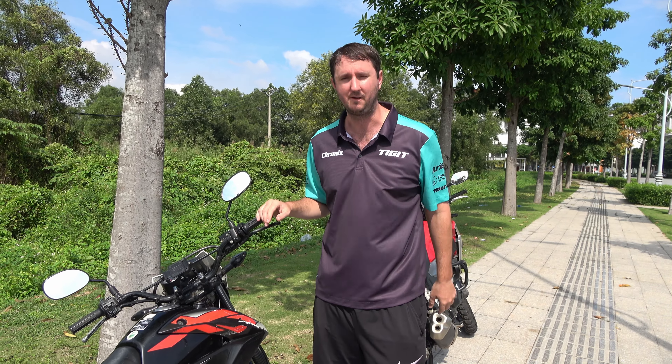You can run out of oil in two different ways. One is that the bike is actually burning through oil. This can be because it's a Honda XR and the engines naturally burn oil, or the piston and piston rings are a little bit damaged. The way you know is it's got white smoke coming out the back and it smells a bit like a two-stroke engine or a chainsaw.